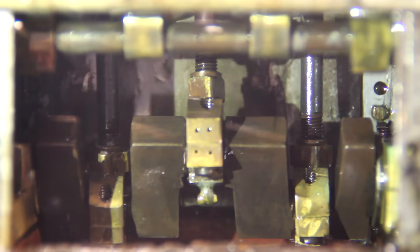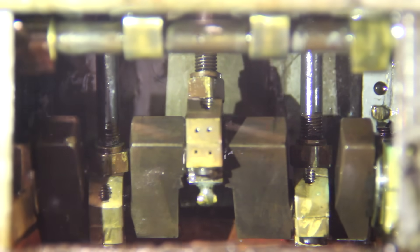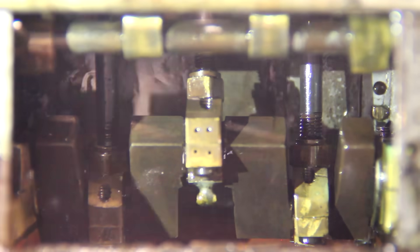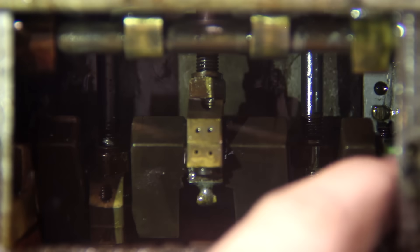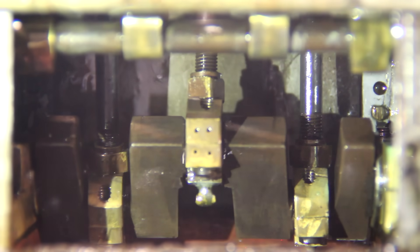As for the structural integrity, I'm going to say it's fine to run it, but it's nothing special. There are big brass blocks on the edges of the crank that are just soldered and bolted to the actual sheet metal crankcase, so all that's really holding this whole thing together is the sheet metal on the outside — which isn't ideal, but there's at least a bearing surface in here, so I feel a little better just running it as-is. I think I'm going to put it back together and see what we've got for compression. Maybe it'll run with what it has; if it doesn't, we'll put some O-rings in it and see what it does.